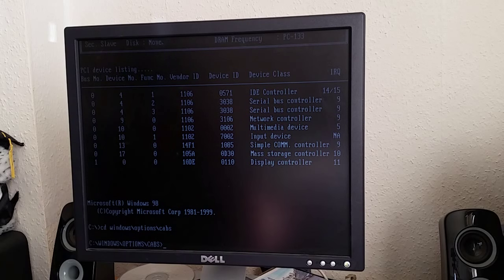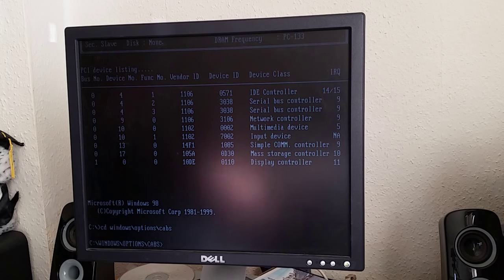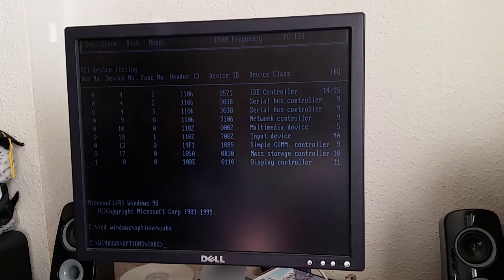Now, UK keyboard users, beware. Because the UK keyboard layout will not be enabled in this mode. It will actually be the US keyboard layout. And that goes for anyone else with an international keyboard as well. So just take note. At least on the UK keyboards, the backslash key may become the hash key, which is the middle row and right next to the enter key.